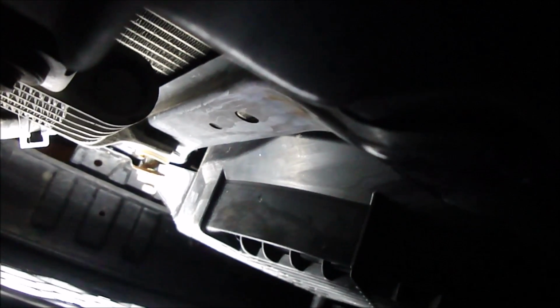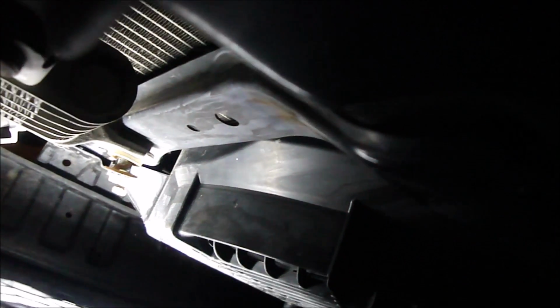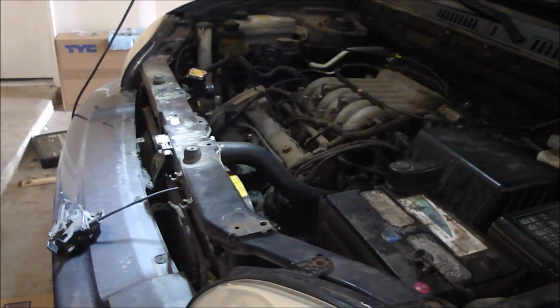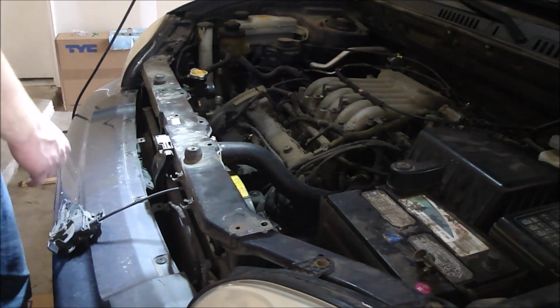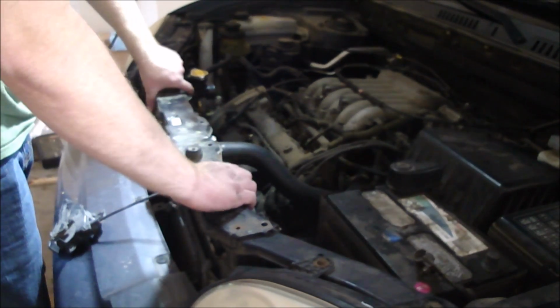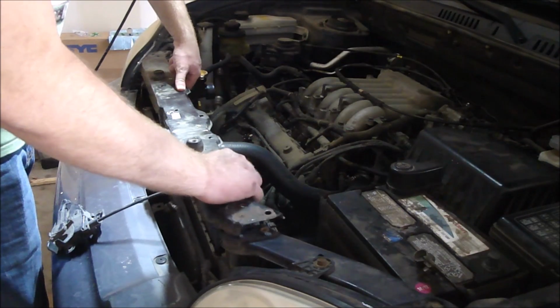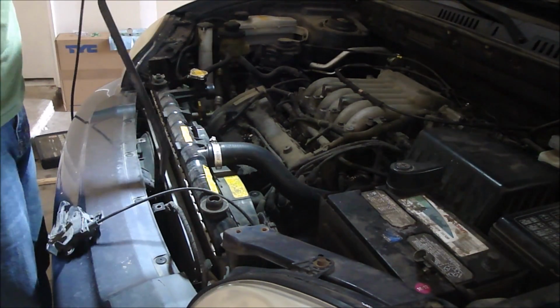To really do some bending. So there's a bolt there, and your oil cooler, and then your air conditioner condenser fan bolt, and then the 2 bolts to that bracket at the very top. I sure hope you can figure out a better way to do this, because that was awful going up from the bottom. But it's all off, should just come off now. Should be able to pull it out. There we go.